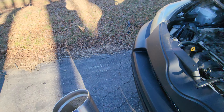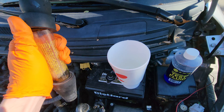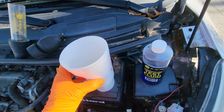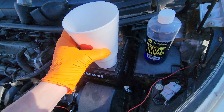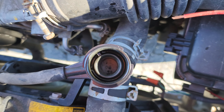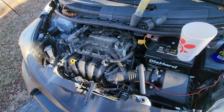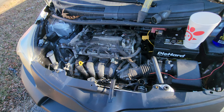I'll use a clean cup — here's my Chick-fil-A cup. I'm going to pour this in so we can better see the color. And you can see how it starts out blue, and this has been changed to a yellow color. So that is a conclusive failure — failure of the head gasket. Let me know in the comments what methods you use to determine if a head gasket is bad or not, and I'd like to hear any insight you have to share. Thanks for watching.